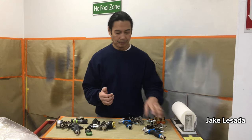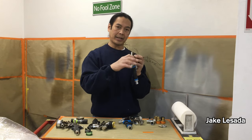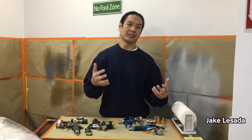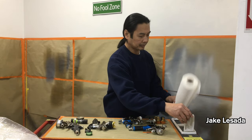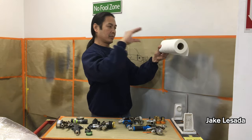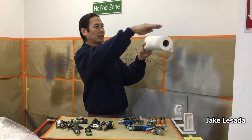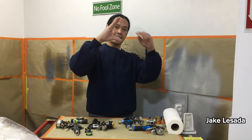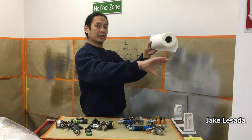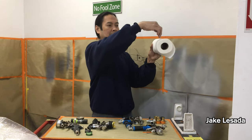If you reduce the fan so you can spray a specific area, when you spray a panel you don't just spray at the edge — you spray in the air. The sweet spot of the fan is sort of right in the center; you catch it there and come through, then come down. That's the most effective way to create an even coating. Otherwise if you start at the edge it's going to be way thin on top.